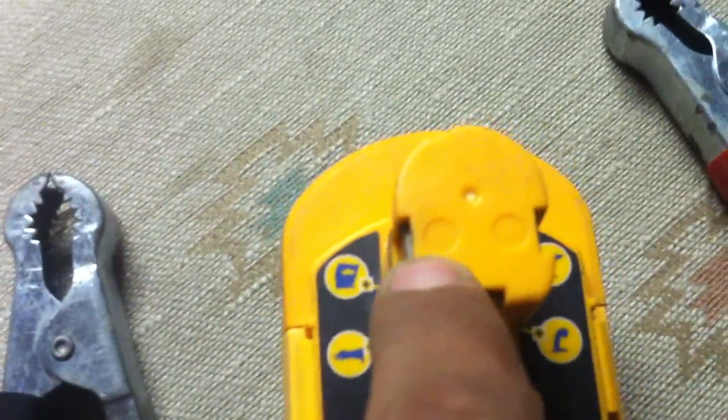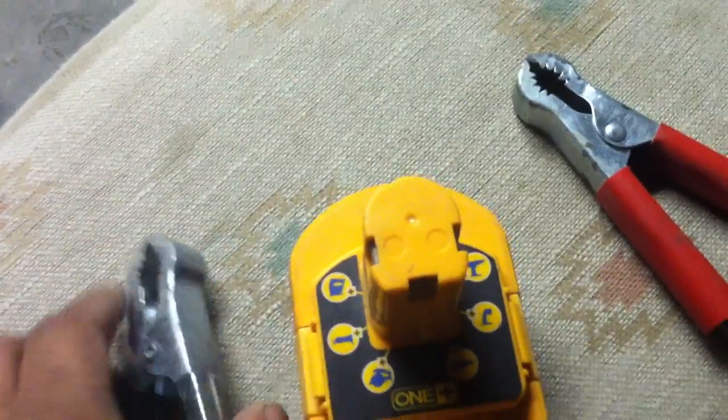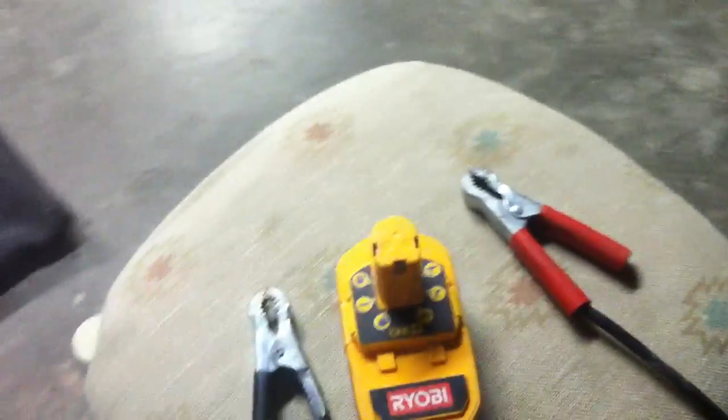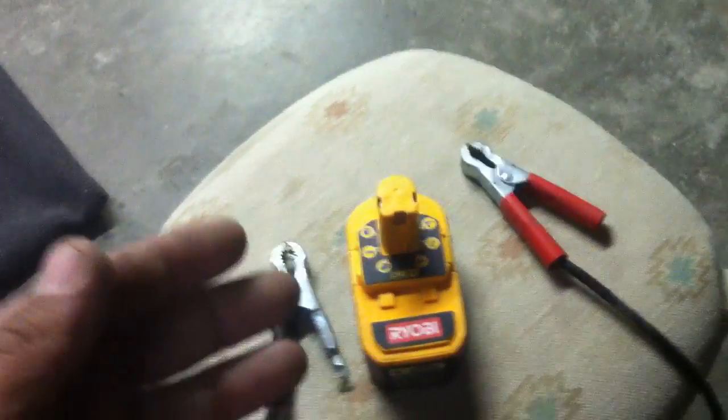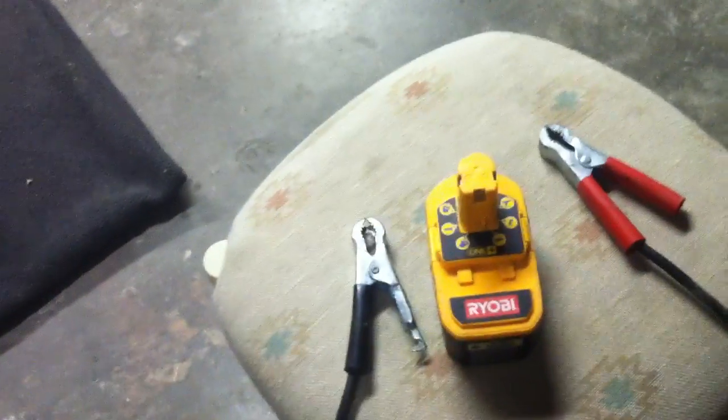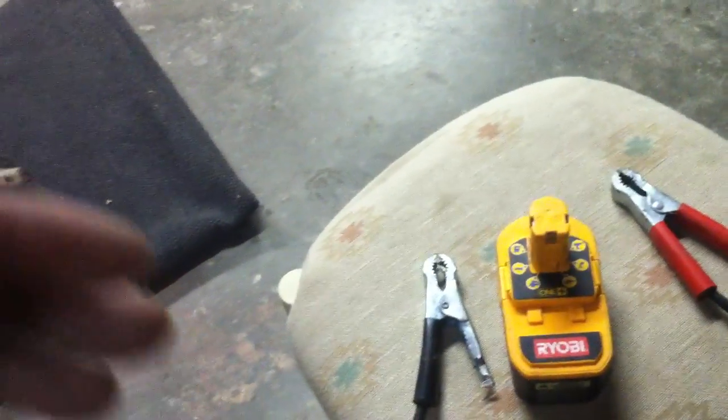I'm going to use a battery charger here. I'm not going to show you a before and after because anybody can trick the batteries and swap in a different one. Simply take your battery charger, touch the positive to where it says plus and the negative to the negative symbol — just touch both sides and you'll get a little spark. I'm setting mine at 20 amps; you could put it at 55 or 2 amps, a trickle charge or slow charge. Just touch it and get a spark. As soon as you get a spark, you'll have a voltage in it. Once it reads a little bit of voltage, it will then take more voltage. Without any voltage, it won't even try.